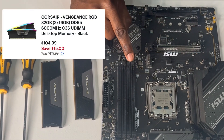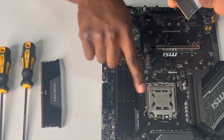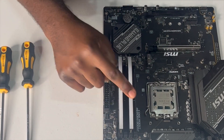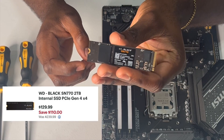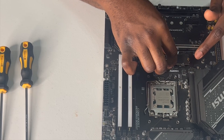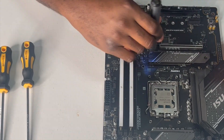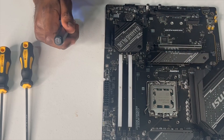The RAM is going to go in the same channels. You want the logo facing to the right, away from the board — and that's our RAM, two 16-gig sticks. Then we have a two terabyte SSD stick. You're going to slot it at an angle and push it down and lock it into place. We're going to take the heat sink for the SSD, put it in. No need to over-tighten these. SSD in, RAM in, CPU in.